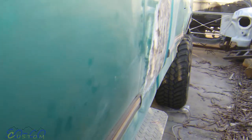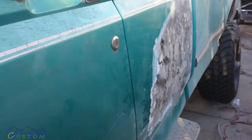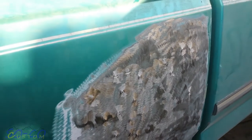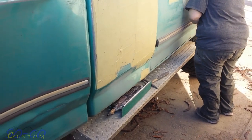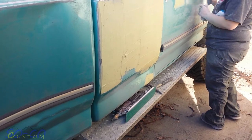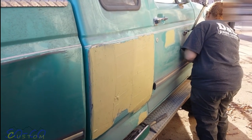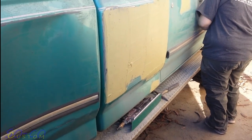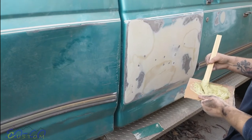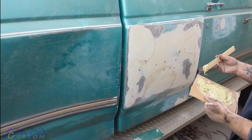I'm gonna get back on the other side before I lose daylight. It's starting to take shape — gonna call that good. Same steps: throw bondo on it like the other side. We just got the air filer ready — 40 grit sandpaper — using the air sander to get that going. She's already working around those little dings on that door that we had.